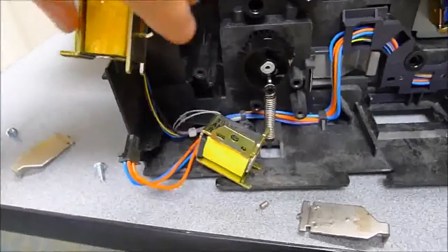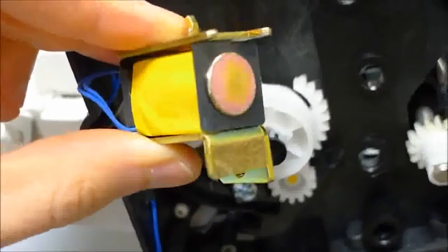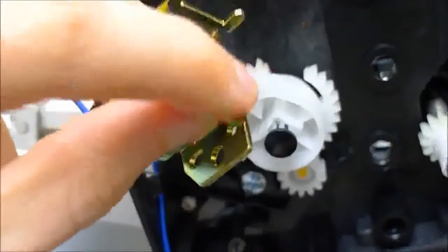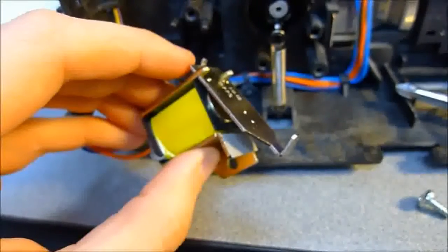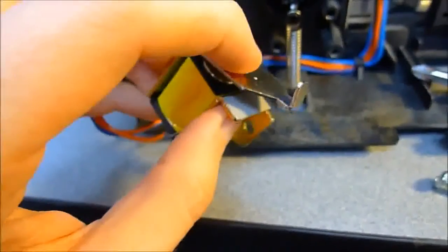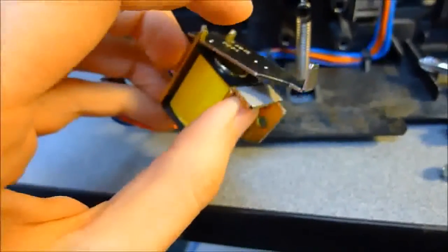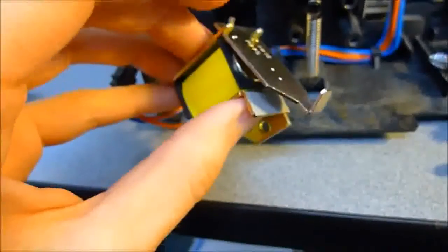Even though it doesn't necessarily have to be done, I've also removed the Tray 1 and Tray 2 solenoids to prepare to clean them. You can see how much crud is on there — that brown patch there is what's on all the solenoids and what you need to remove, because it gets really sticky with use. That is the main cause of the sticking issue. Once you've taken care of those solenoids, right before you put it back on, give it a try — you should be able to press on the armature really hard and still not have it stick at all. That means the electrical tape is handling the adhesive issue and we won't have any problems with residual magnetism either.